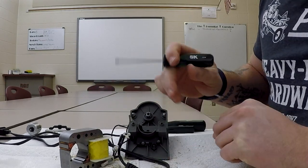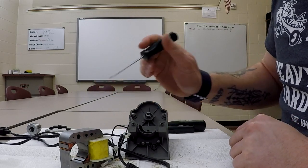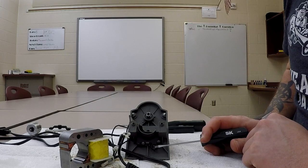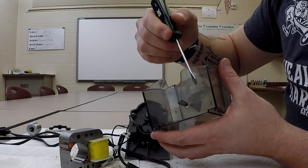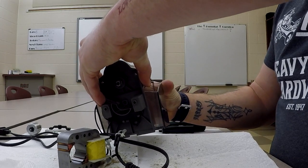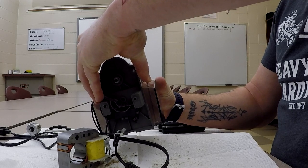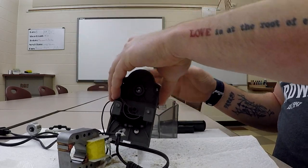Now, I'm not going to disconnect wires at this point, but we just have two power wires, very basic wiring arrangement. You have two lockout switches. So this is lockout number 1. All right, so unless you have the cup, this part, that right there, sticking through the switch, okay, and we'll push it in there just for fun. Okay, that actually doesn't sound bad. It might have dirt in it too. Unless that's in there, it won't turn the motor on.